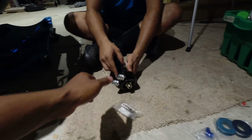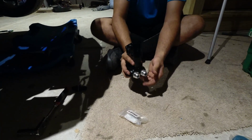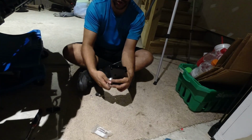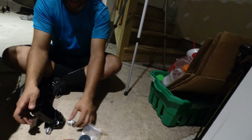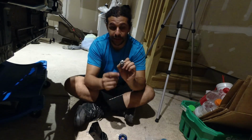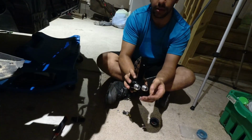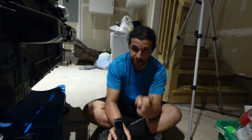You're going to have to orient this a specific way so that if this is facing the block, this is facing out. You will be provided with 2 oil cooler fittings and you will have 2 side holes for your oil temperature and oil pressure gauge. The AN fittings for your oil cooler do not need to be Teflon taped. Teflon tape is a type of thread tape used for sealing pipes and things that have fluid going through them. Do not Teflon tape these. They have an O-ring here to seal, as you can see. These you tighten by hand, and then you take a socket or a pair of pliers and you tighten them on. You want them pretty snug. You don't want to kill them, okay? So these will go to your oil cooler, and they need to be facing the passenger side.